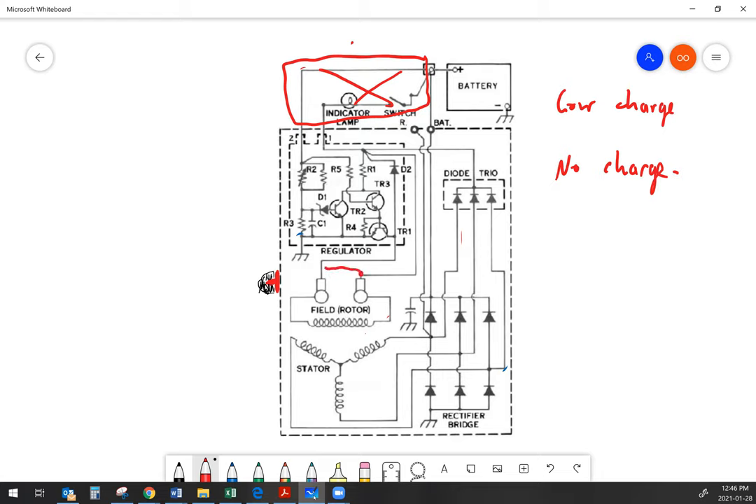There's going to be a wire or connection inside the alternator that hooks up to your positive brush lead. To excite the alternator, take that rubber cover off and momentarily hook a wire up to battery — just jump it enough to make a spark — and the alternator should turn back on because you've turned the rotor back into a magnet. On some pieces of equipment you do have to rev the engine up to get the alternator to turn on, because you've got to get that field moving fast enough past the stator to induce some current flow through your diode trio so the field can turn on and start working properly.